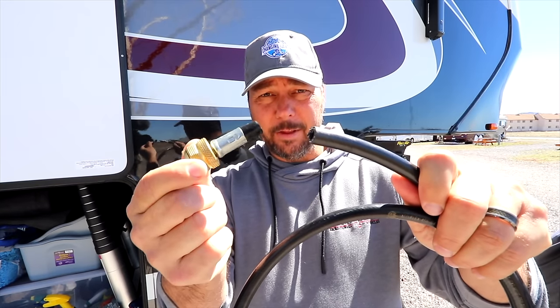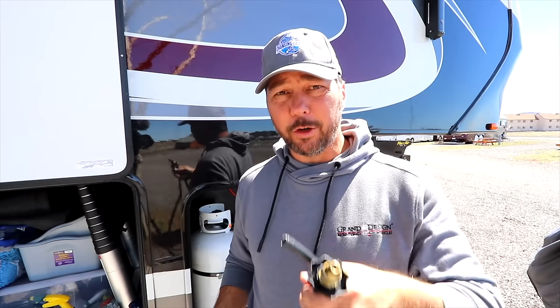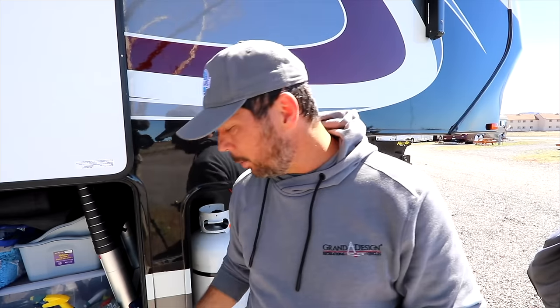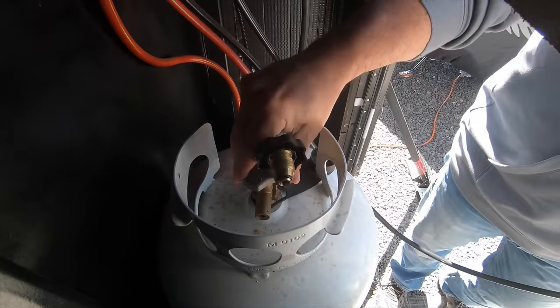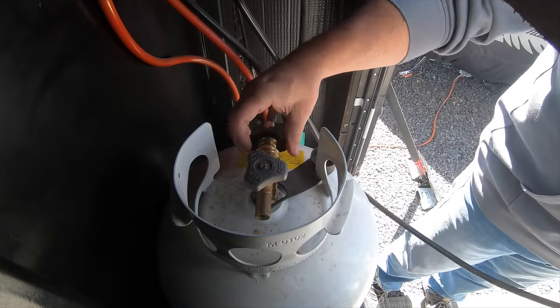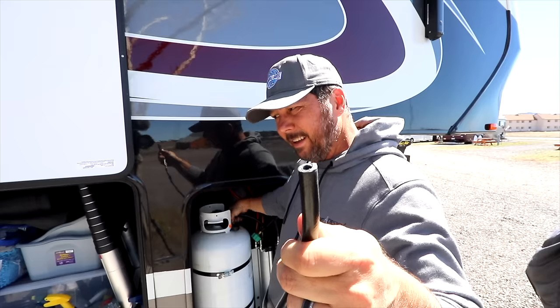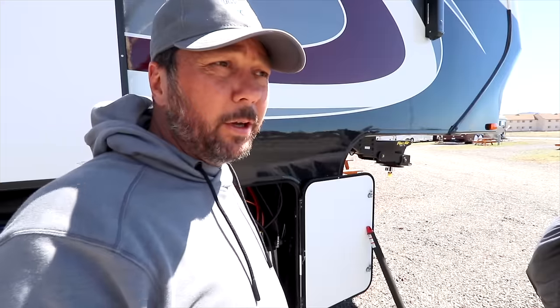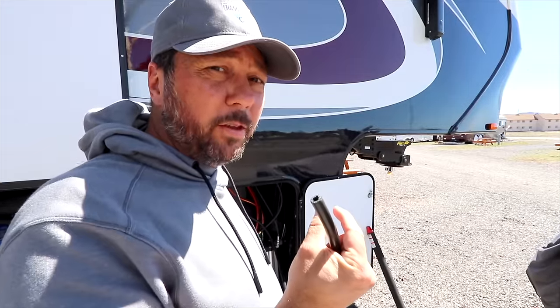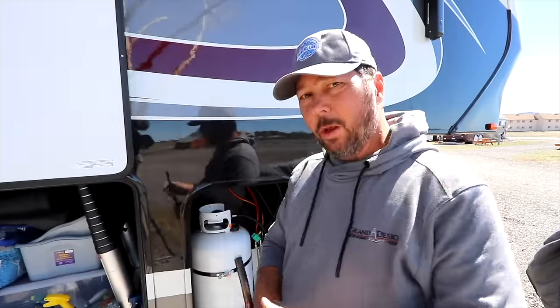I snipped off the end. So now I can test a leak by pinching the end here so it's shut and then releasing it, simulating a quick leak. So we're gonna try it once without and then once with the gas stop in it. So let's connect it up here, shut off. You might be able to hear the OPD valve release when I connect this. There it goes. So basically what you're hearing there is what little bit of pressure there was in the OPD valve being released, and the EFV valve will kick in when I open this up.